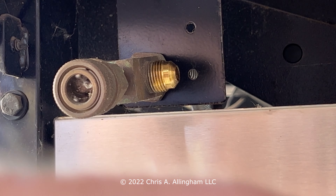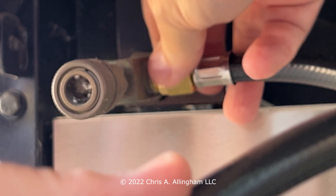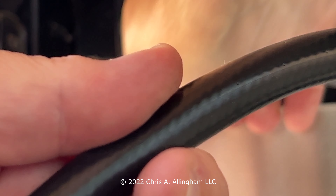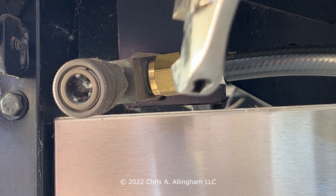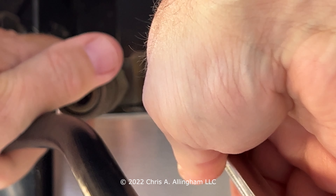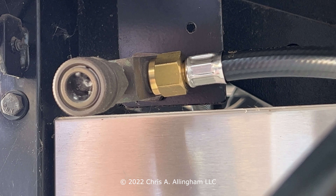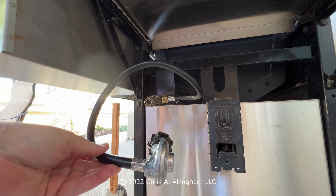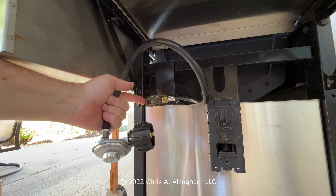Let me get the hose. This is just a matter of threading this on. It goes on very easily — doesn't need any kind of lubricant at all. That's finger tight. Now let me just give this a little twist here, sort of stabilizing the fitting. Just that's tight enough right there. There we go — there's our new connection. Here's my new regulator connected by the new hose to the new fitting that connects to the old gas intake on my Weber Summit 450.